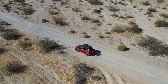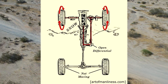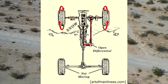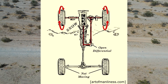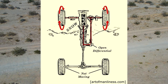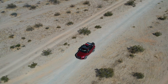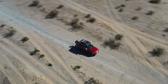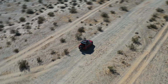On the flip side, an all-wheel drive system, which allows different rotation of the front and rear axles because it has an open center differential — well, the downside is power goes to the point of least resistance. When you're going over terrain that is much more tricky, you can end up having all your power go zipping out to a spinning wheel and then you're stuck. The T8 hybrid powertrain has the potential to be the best of both worlds — guaranteeing torque to both axles like a 4x4 system, but also allowing variable wheel speed like an all-wheel drive system.